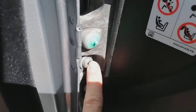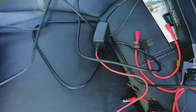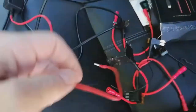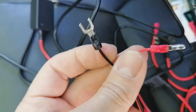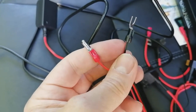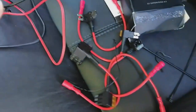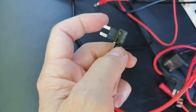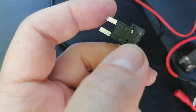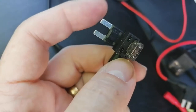I'll show you the cable — this is the cable that comes in the box. On one end we have a micro USB to power the actual item, and on the other end it's really simple: we've got a plus and a minus. The black wire is going to go behind the bolt I've just shown you. The other wire is for power and we're going to use the fuse box for that. The kit comes with all these different fuse spurs — a fuse spur is basically a socket doubler. You pull a fuse out and there's a two or three amp fuse just there to run something like a dash cam or in this case the Road Angel, and the original fuse you pulled out goes in the socket next to it.